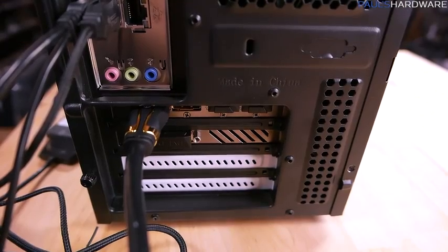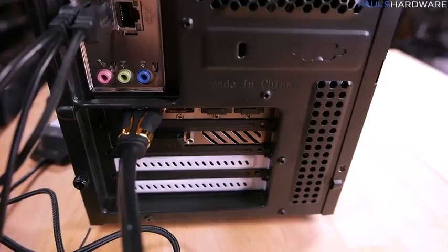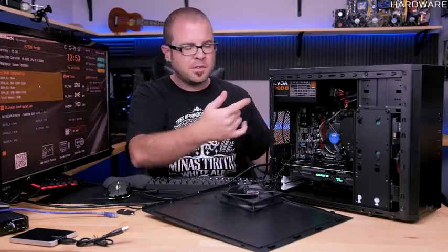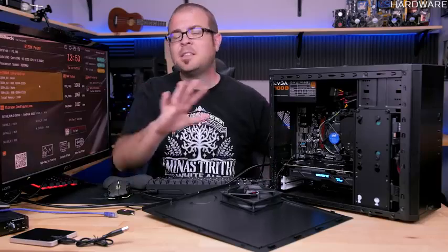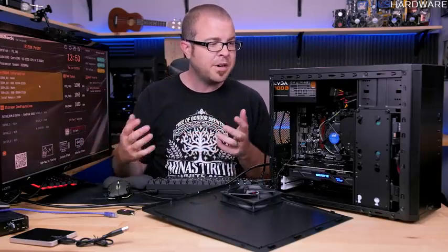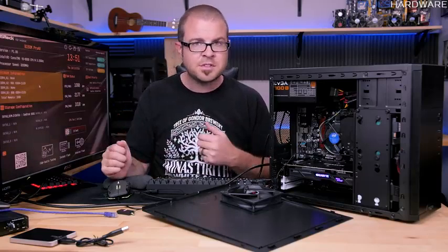I have currently plugged in the monitor via the HDMI plug on the graphics card down here at the bottom. You can check the video outs on the motherboard themselves, even though you're not trying to use them. And then, of course, the audio, and possibly even the other display outs on the graphics card. Again, that's being completely thorough. I'll admit I don't usually do all that stuff, but it is something that would be good to check right off the bat, just in case you have a faulty port or something like that.